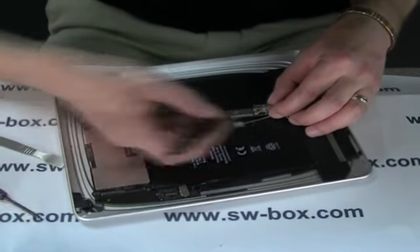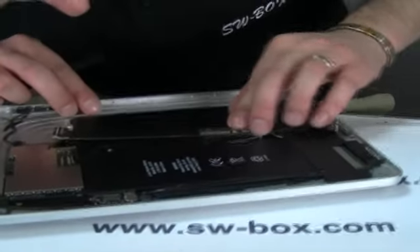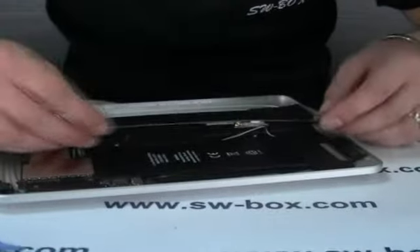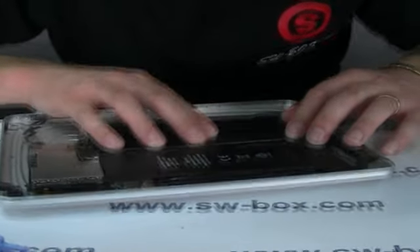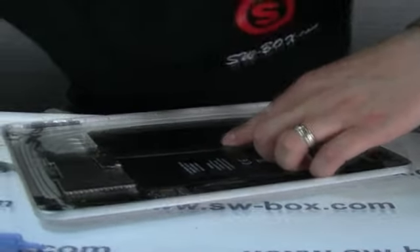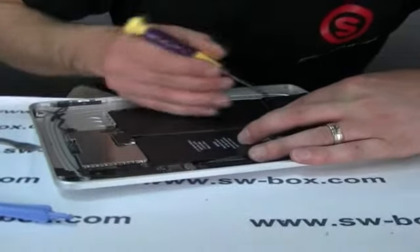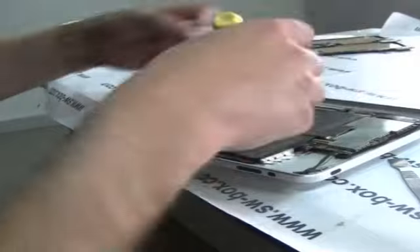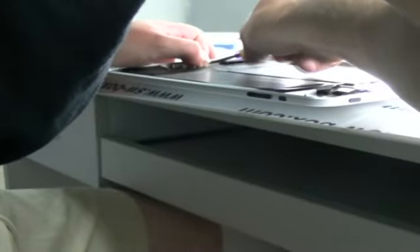It's not easy to put back on because I had this earlier when I first stripped it down today. There we go — it's in place. Now we're just going to turn the charging port back over and make sure we can get the wires out. You make it look real easy, Neil. I don't think it's that hard. I'll put that centre one in first. Once you get them started, it's not always best to tighten them right up in case the others don't line up — it's best to leave them a little bit loose and then go back to them, like changing a tyre.